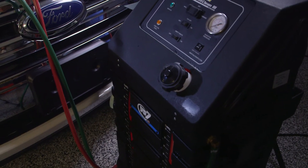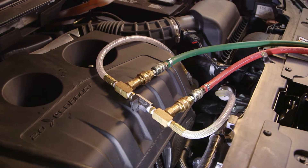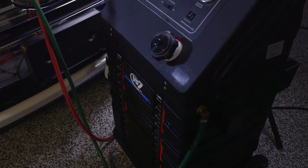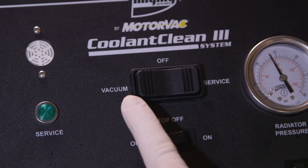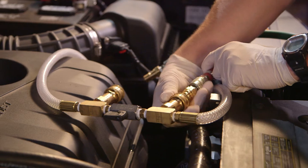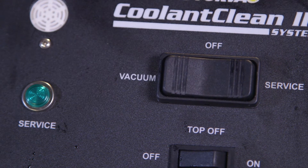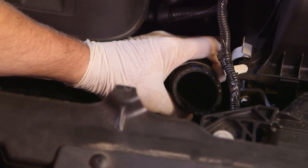The unit will begin pumping new coolant toward the thermostat while creating suction on the opposite side of the system, removing the old coolant. The push-pull process holds the thermostat open for a thorough coolant exchange. If coolant is not flowing, set the machine to the off position and switch the hoses to the opposite ports, then restart the machine. The process is complete when the Coolant Clean 3 new fluid level reaches zero. Use the top-off or vacuum features to add new fluid or remove excess fluid from the radiator and/or reservoir. Disconnect the adapters and connect the upper radiator hose as it was prior to the service. Add the VS7 cooling system conditioner to the radiator. The Coolant Clean 3 vacuum feature will be employed to make room in the upper radiator for this product, or the product may be introduced to the open upper radiator hose prior to being reconnected.